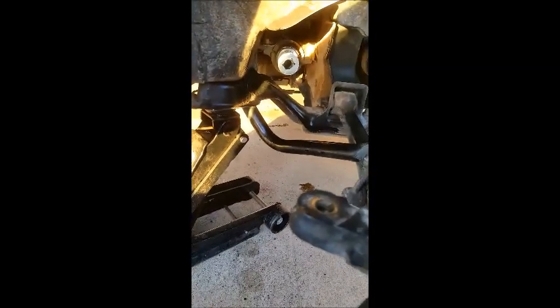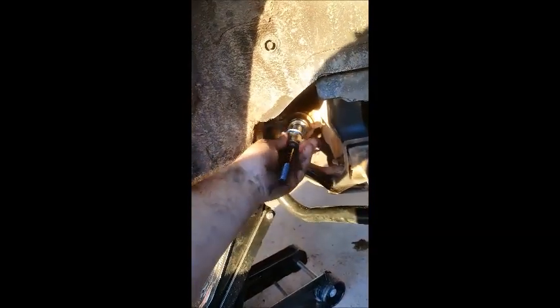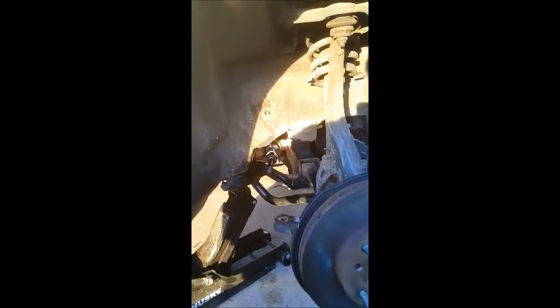Now there is a little bracket that you put right here. Put the little tabs right where they line up right there, and then you just screw the other one back in. If you look at the old one, this is where we took off this back part right here, and you'll want to do the same thing on the new one. You can actually just use a flathead and just bang it back in to keep it more in place. So we'll screw this back in and go clockwise here. That's how you change the outer and inner tie rods on a 2001 Honda Accord four-cylinder LX.